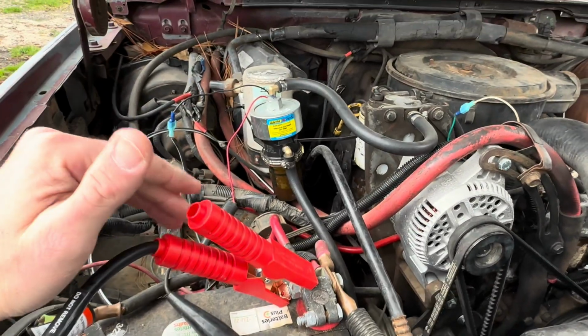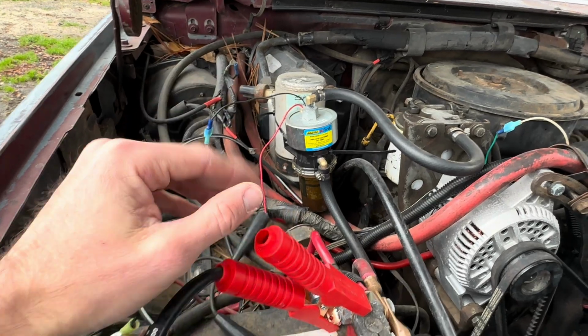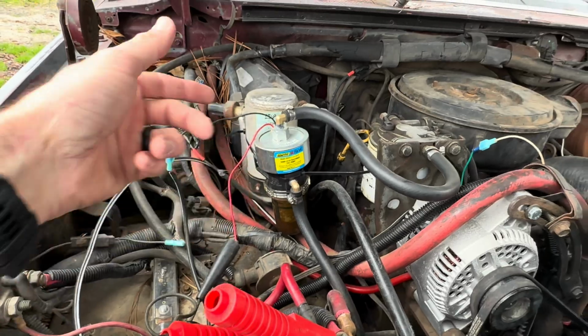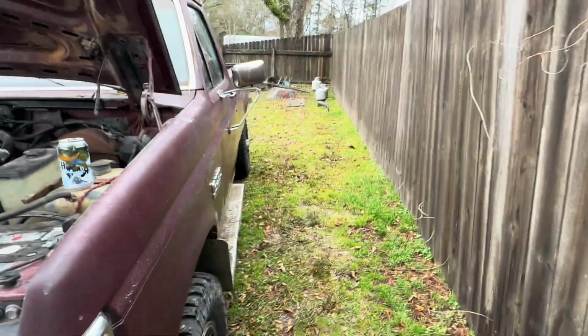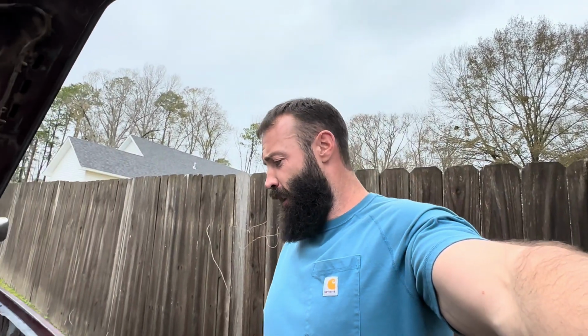But I was driving it three or 4 days ago, and it was dying on me before I got to the house. And I know why. I unscrew that, get a new filter. But the problem is these old tanks on here. It's the original tanks, and that stuff is nasty. When I did the fuel filter video, we changed the fuel filter for the first time. It was the same. I mean, it looked like straight rust water.